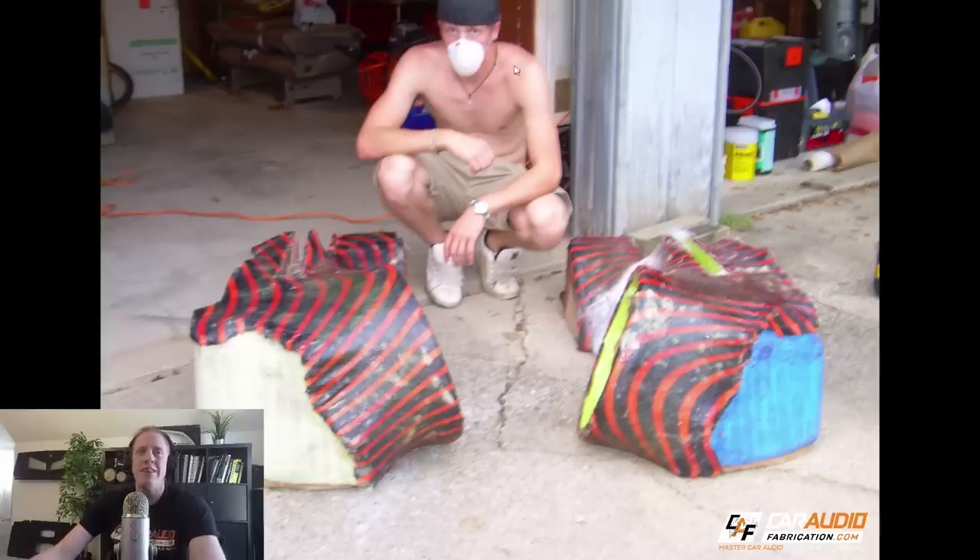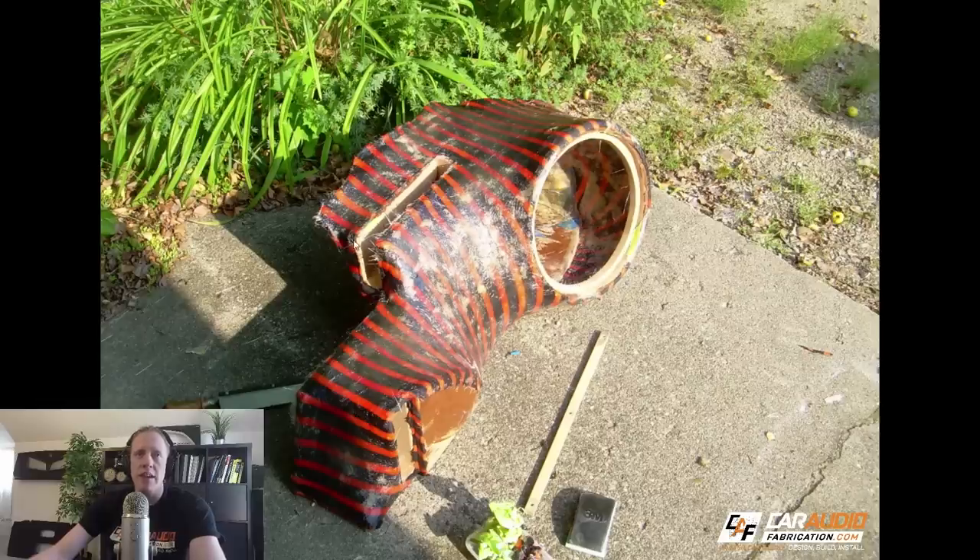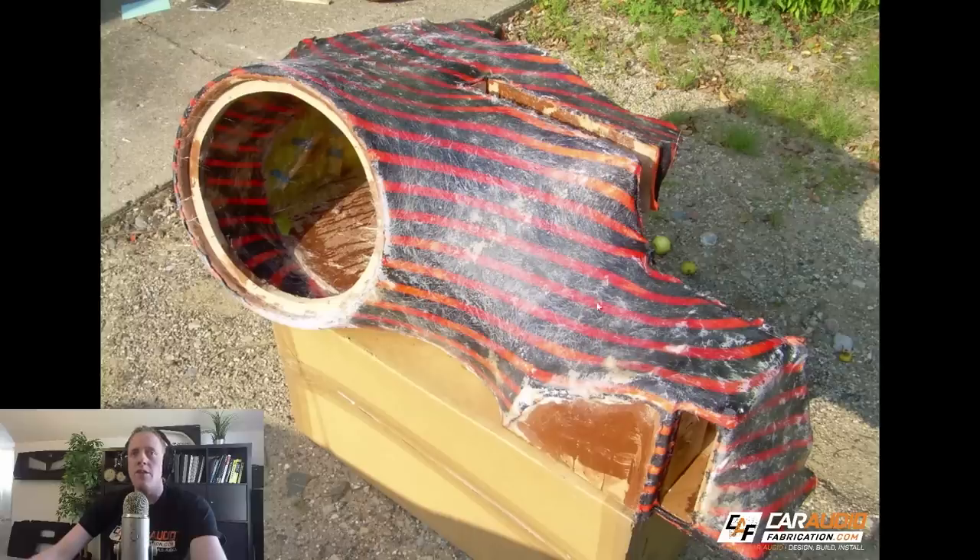Here's a classic picture of young Mark with a face mask on for dust protection. At this point I've now peeled off a majority of the tape - it looks somewhat clean underneath, but I definitely have some rough edges around the port and around the ring to deal with through body filling. You can see all these light white spots - what a lot of that is, is more bubbles. You really have to make sure when you're laying the fiberglass mat, you use something like a fiberglass roller to really roll out those bubbles and make all those fiberglass layers adhere with each other perfectly.